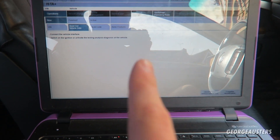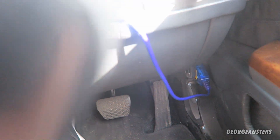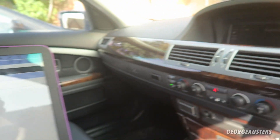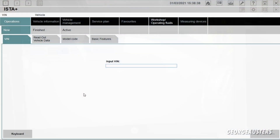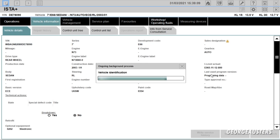Okay, so let's get started. As you can see, I have ISTA loaded up on the laptop. I have my DCAN cable plugged into the OBD port. I'm just going to insert the key and turn the ignition on. Now we'll move over to the laptop and I'll show you exactly what you need to do in ISTA. The first thing we are going to want to do is read out vehicle data — it's something you have to do to pretty much do anything in ISTA. It's essentially where all of your modules get scanned and you are made aware of any fault codes that exist.